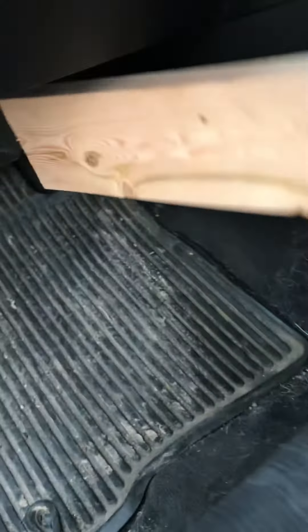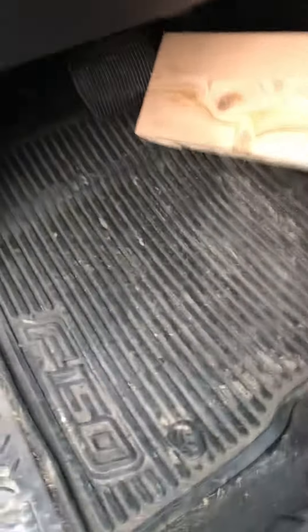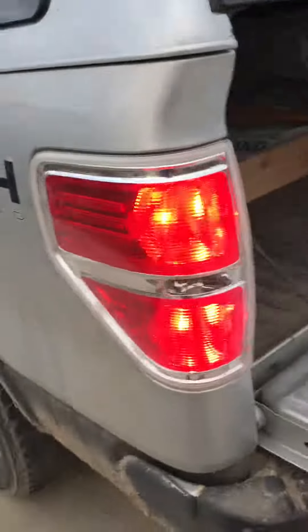People tell you to just tap into the brake light directly, but if you do it that way, the way these things are made nowadays, your camper topper light will blink when you put your blinker on — because it's the same light. So now when I have my brakes on, the topper light works and it doesn't blink when you turn the blinker on.